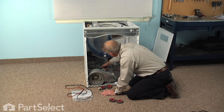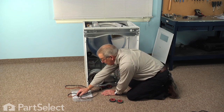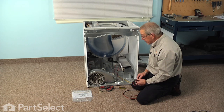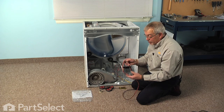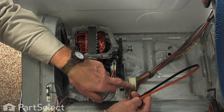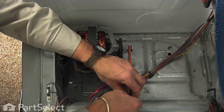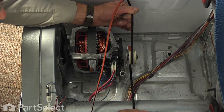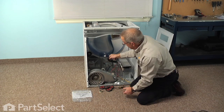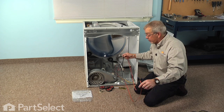We're now ready to reinstall the drum into the dryer. If the belt was broken on your old dryer, you may not know how the new belt will install. When reinstalling the belt, we need to know how it will fit around the idler and the motor pulley — it will basically look like this. That will allow the groove side of that belt to lay up against the drum and provide spring tension to keep it tight. When installing it, we're just going to drape it over the drum, lift the drum into position, and then we'll install the belt onto the idler pulley and motor pulley once we have it in place.